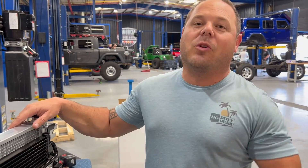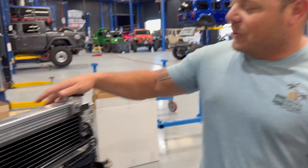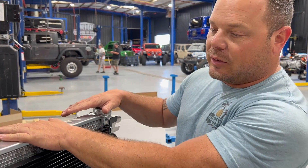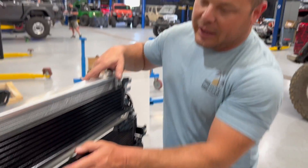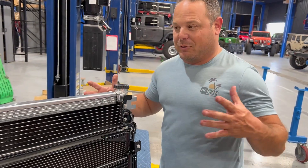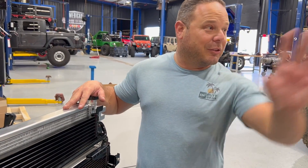If you were wondering how we're going to cool a Demon engine - especially living out in the heat - here you go. We've got an aftermarket larger radiator that is also an oil cooler, so it has both coolant passages and oil passages running through it. We also have a transmission cooler, a power steering cooler, a condenser, and right in here is the intercooler for the supercharger. A lot of coolers - a lot - to keep it cool. This whole stack fits on the front and goes in as one unit.